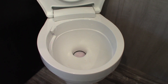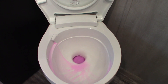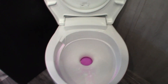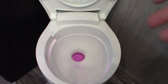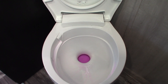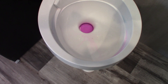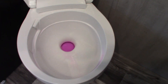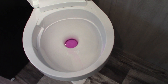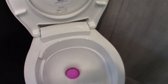The toilet is an RV toilet with a flush pedal, and it sits right over the black tank. You cannot use an RV toilet dry — meaning with no chemical or water in the black tank. If you do, the smell will be terrible and it can get clogged. When you get to the campground, put a dose of chemical in, then hold the pedal down until at least a gallon of water goes in with the chemical. Don't use less than a gallon. You always have to have water and chemical in there before you start using it.